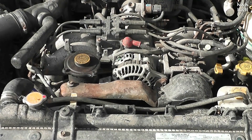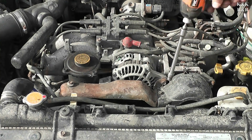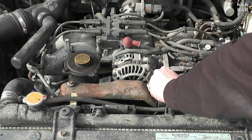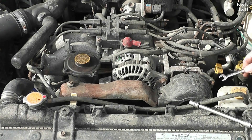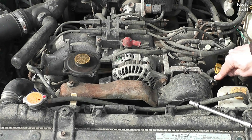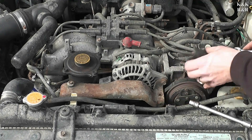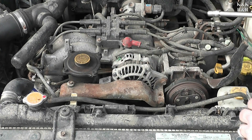After you have disconnected your battery, whether you take it out to charge it or just disconnect it — make sure you disconnect it. Next, we're going to get these covers out of the way and get the belt out of the way. Most of this is going to be 10 and 12 millimeter. These fasteners are really small so you want to keep them in a safe place. Some of this might be a little rusty. I like to keep my teardown as simple as possible. Some Subarus, some people have already ripped the covers off, but if you have them, I like to put them back.